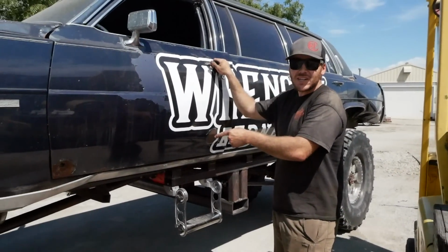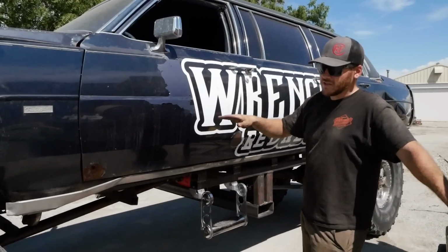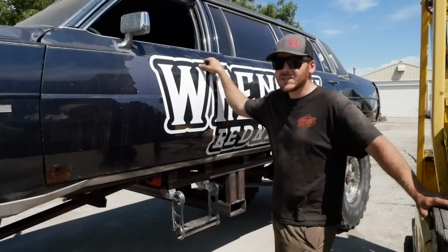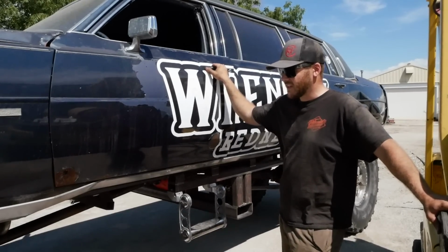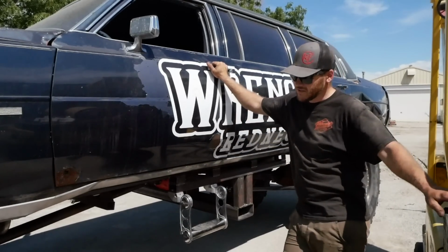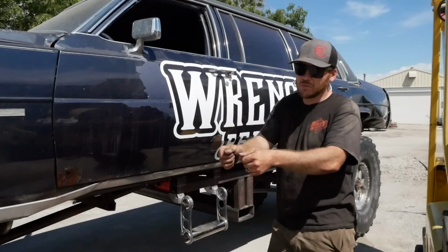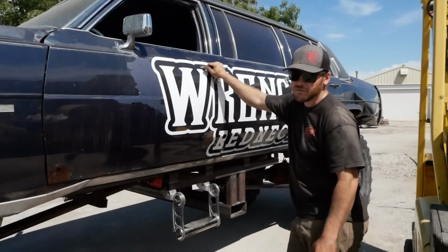We also messed with the transfer case because I got that twin stick, and it just didn't seem like it was working properly. It didn't seem like it was in 4 low. It feels a lot torquier that we have the 513 gears under it, but it still didn't seem like it was in 4 low for what it is with that motor and everything else. So I unhooked the linkages and manually shifted the transfer case, and basically both levers got to be pulled back, which during the truck pull I had them forward, which is high range for both axles. So I was never in 4 low.